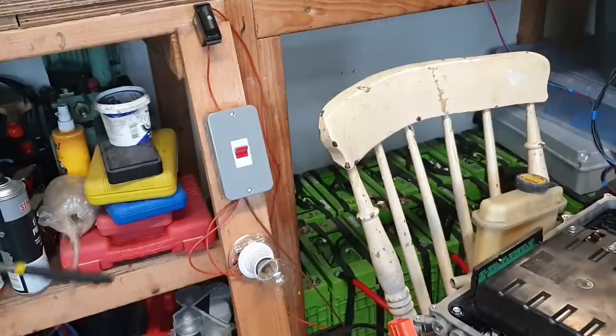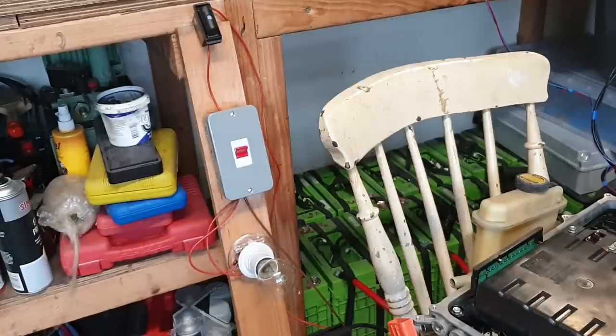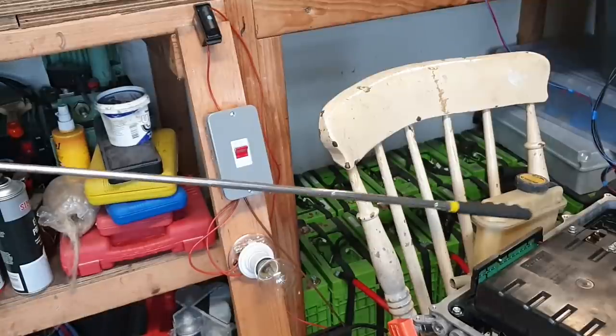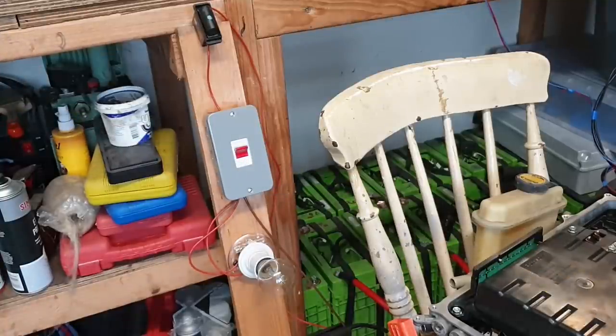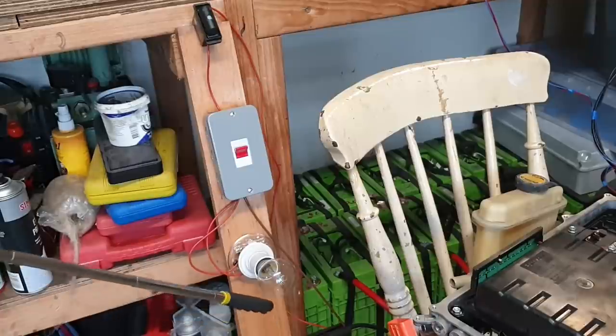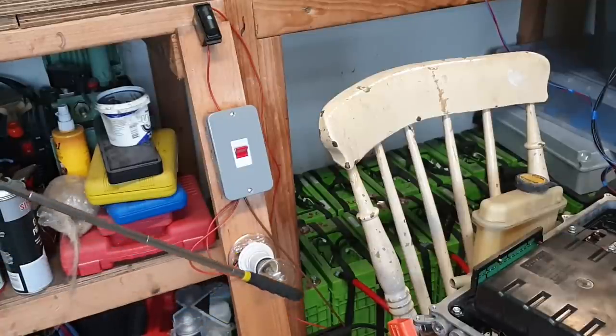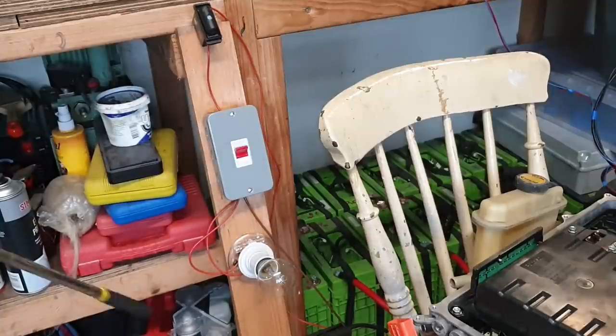So just like we did with our 12 volt power, we're going to do a similar thing here with our high voltage. And the reason is, again, we could have a bad inverter, we could have connected our high voltage wiring backwards, we could have accidentally connected the battery backwards, we could have a short, we could have any number of problems in our high voltage side here. And a simple, you know, I don't know how much these things cost, but let's say €1 light bulb will provide all of the safety that you need here in order to not destroy something, you know, damage your inverter, damage a lot more stuff.